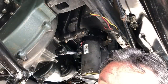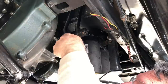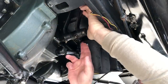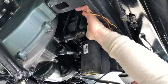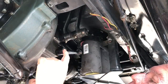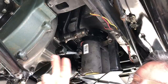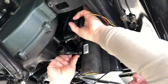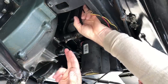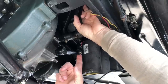Welcome to the underbelly of my two-door sedan, where safety is the highest priority. Here you can see where the brake and the clutch pedals mount right here, and right here is the linkage for the clutch. This obviously being the clutch housing, this little arm right here — this shaft is what connects to the forks that push the clutch forward and let it go backwards. When you push the pedal down, see how it pulls up on this? It pulls up, that turns that shaft, pushes those forks forward. That's how the whole thing works.